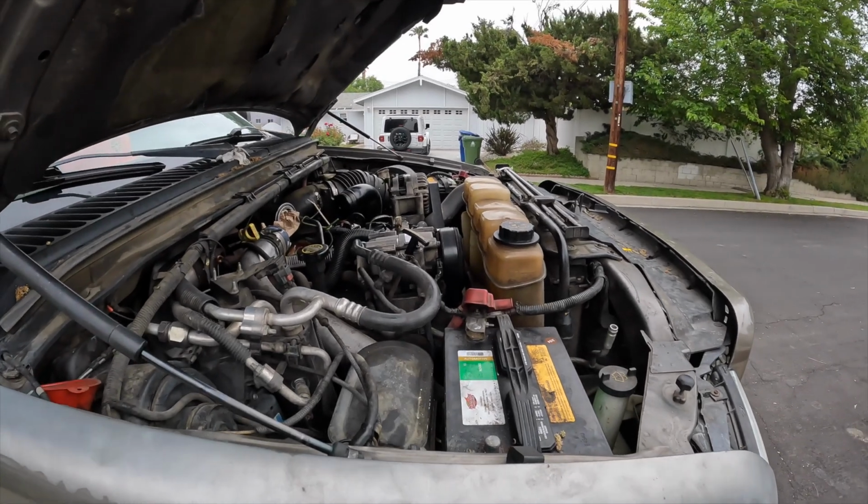Interestingly enough, the truck's been sitting for a week, and on the reservoir on top of the oil pump, when I went to drain the oil, there's no oil in it, which leads me to believe it could be the low pressure oil pump, or somewhere there's a leak, it's draining back down. But like I said, I had a diesel tech come over who's been doing it forever, worked at a dealership, has his own shop now, very high regard man, and he said that's what it was. So that's the update. More to come.